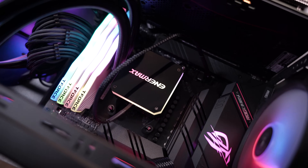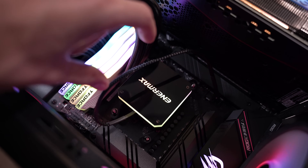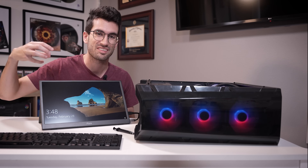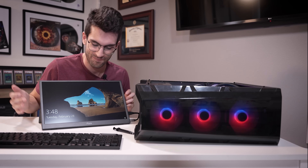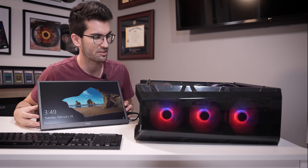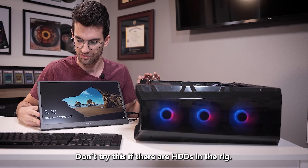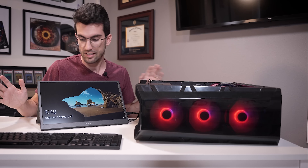I don't really think this is going to change without replacing the motherboard. I'm going to give it one more shot and see if we can just tickle these things on just slightly, just enough. So we've gotten it to work so far — I've kind of just slowly torqued things back down and tried to distribute pressure as evenly as possible, torquing each screw on each corner just a quarter of a full turn over and over again. Maybe that's all it took. So what I'm going to do is simulate what's going to happen when this rig is tossed around in cars — I'm going to pick the rig up and lay it upright while it's on and see if the system stays on. Then we'll power off, reset, make sure it posts again. If that's all it takes, cool, we'll call it.